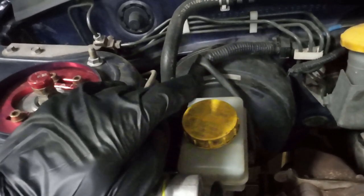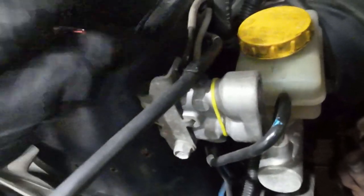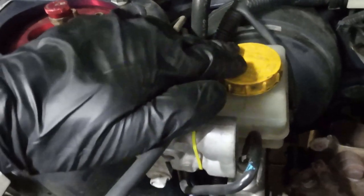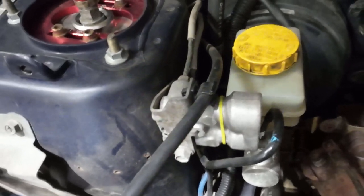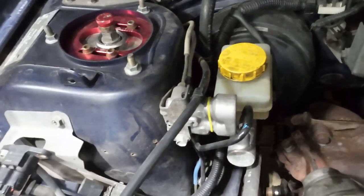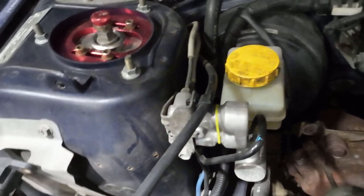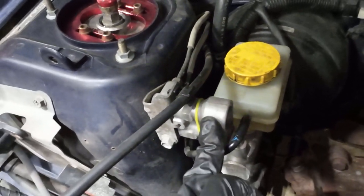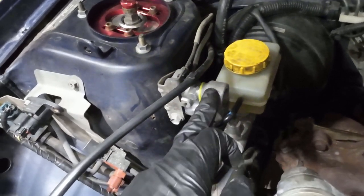Here's what it looks like from factory. You've got the factory master cylinder connected to your pedal via a brake booster, and this gadget here is a brake proportioning valve - a factory valve. That valve is fitted to limit the amount of pressure going to the rear wheels. The master cylinder can provide enough pressure to force equal or more pressure to the rear, but because the rear brakes are smaller, without a proportioning valve, jumping on the brakes would send more pressure to the rear, causing the rear brakes to lock up first - which in a road situation could be particularly dangerous and put the car into a skid. In a rally car with a hydraulic handbrake, we remove this from the line because we want to manually control the brake pressure.